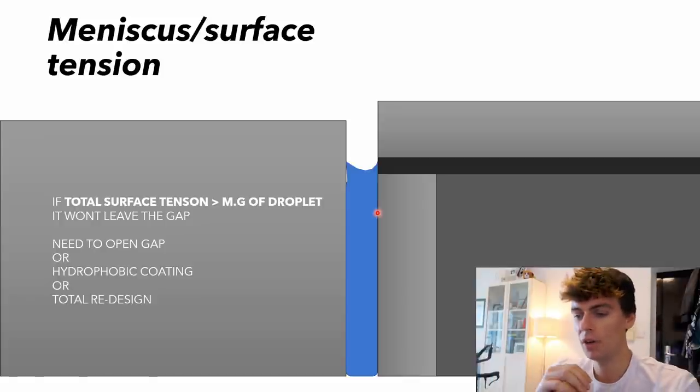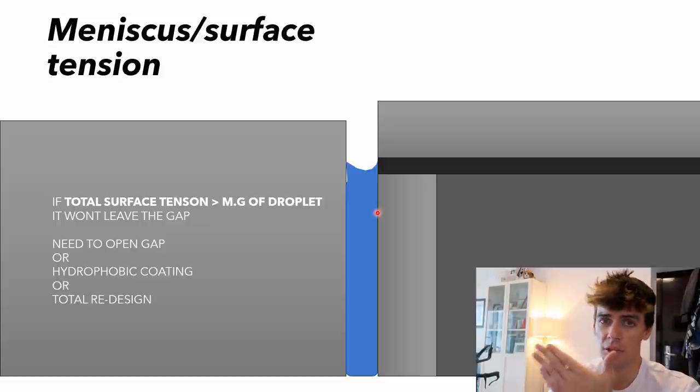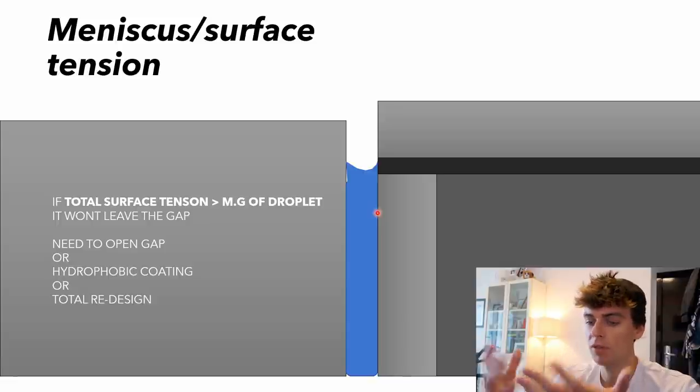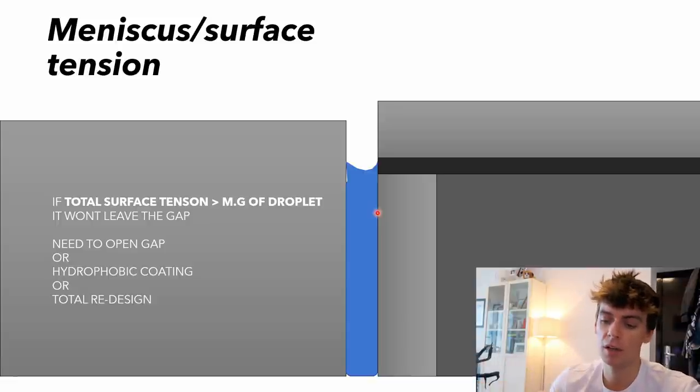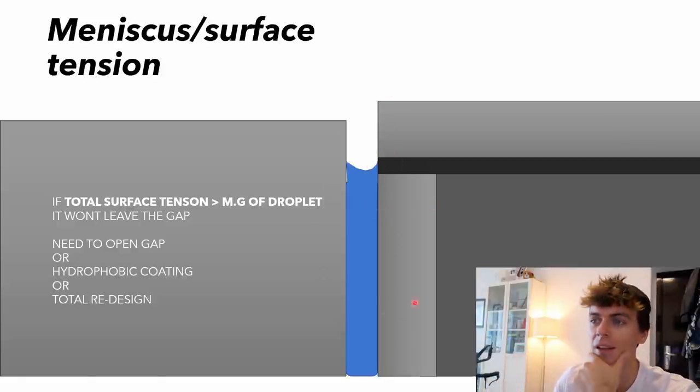If you've got an old car that rusts, you'll expect the rust to propagate at panel gaps or where two members of the chassis are bolted together, because of this surface tension problem, it's hard for the water to leave that area, and you've got a large surface area. So rust on a car panel won't start in the middle of the panel. It generally happens between two joints, or that's where it spreads from. And it's exactly the same here. It's not rust because it's epoxy, but it's the same physical scenario, I think.